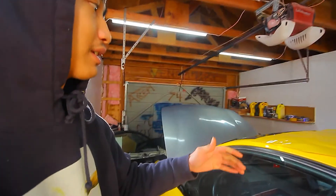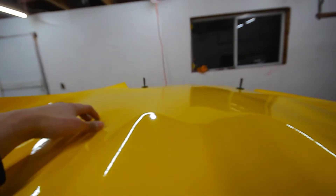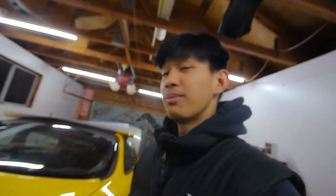I'm thinking about taking out the headliner to get the roof section out of there. I'm going to get these sun visors down, pop it out, and it should come down — might need to take out that little hand-grip thing too. Wrapping the roof is very straightforward. It would be easier with somebody to stretch it over and pull on each side, but since I've got no one I'm going to anchor it in the middle and then stretch it all the way out to each side. Running out of battery so there won't be a clip of wrapping this hood, but you'll see it anyway.